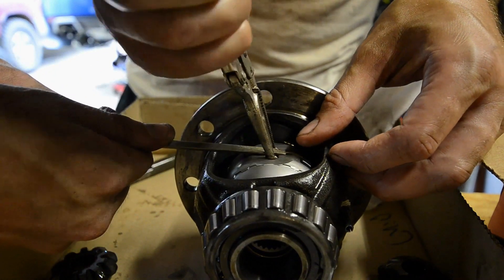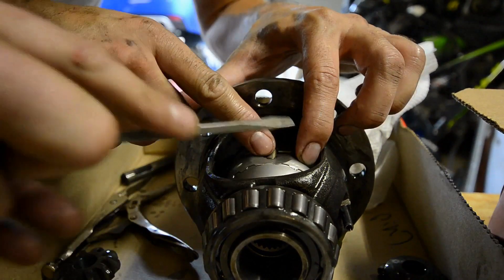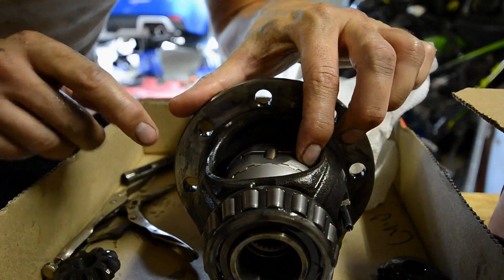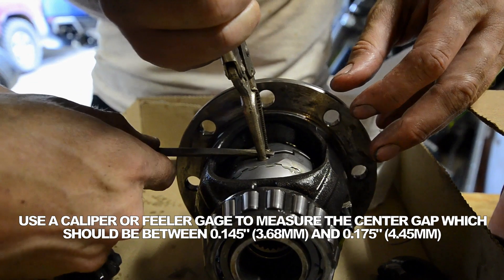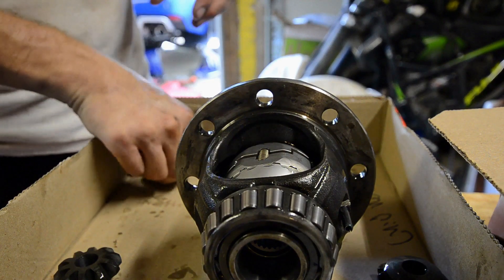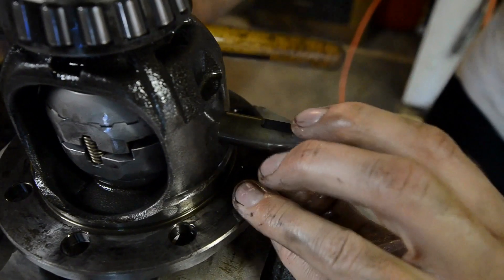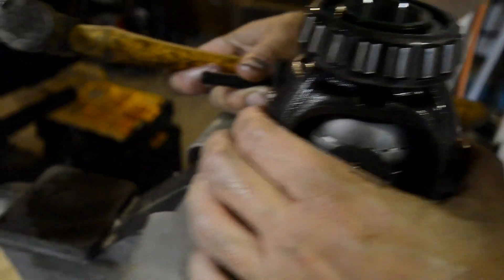Put a flat head on it and press. Let go — and voila. Give a little press just to make sure it's seated. You can see there's about a millimeter of overlap on the end that keeps it from flying out under centrifugal force. The needle nose fits right into these little pockets. Now — can't forget the tension pin. Make sure your flats are parallel to the mounting surface for the ring gear; otherwise your tension pin will not go through. Try to avoid smacking your bearings.